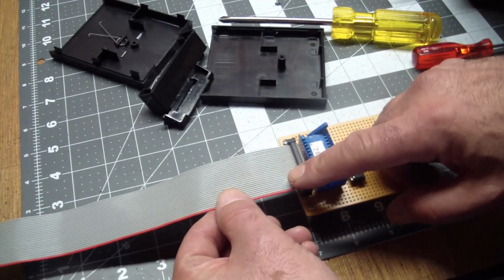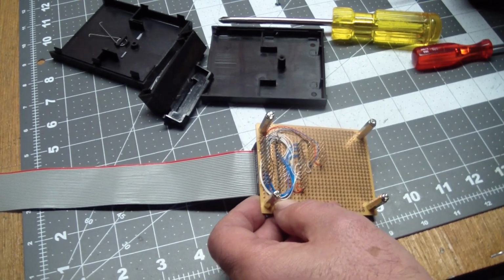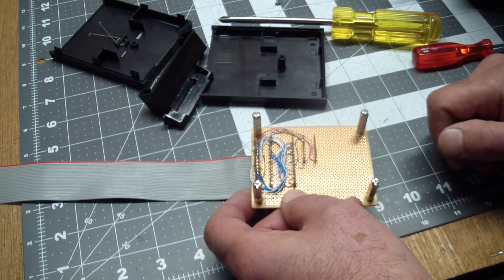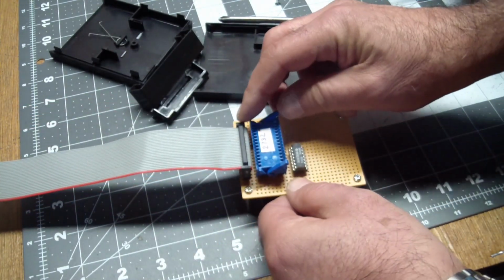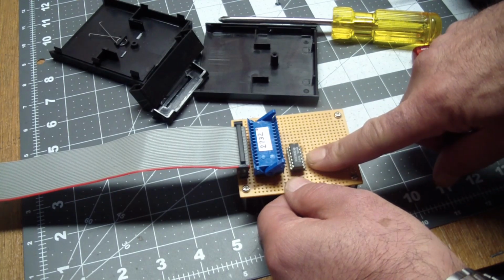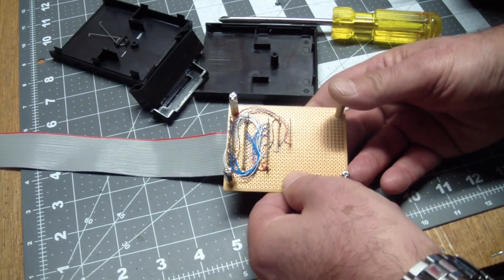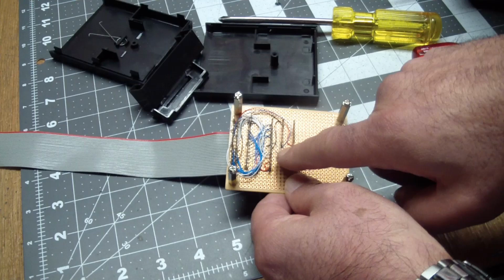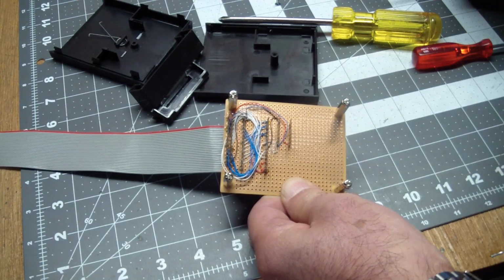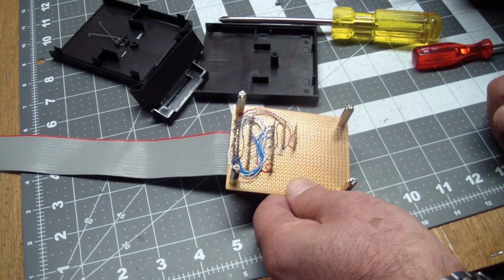It ends up in here, which, using the highest technology as you have come to expect from Artifact Electronics, just wires it all straight to the socket. It has a zero force insertion on it, so we can easily put Eproms in there. And the before mentioned inverter is right here. And as you can see from the wiring, all you do with it is it's got power and ground on it, and then it takes address A12 as input, and the output is run to the chip select line. And that's really all you need to do to play a 4K and also a 2K game image.